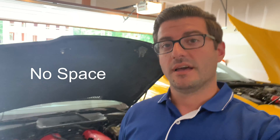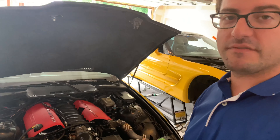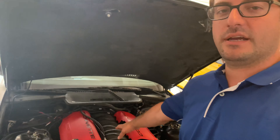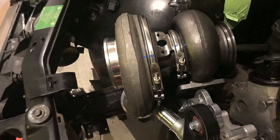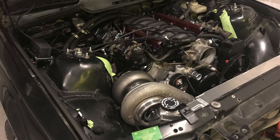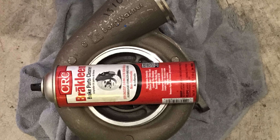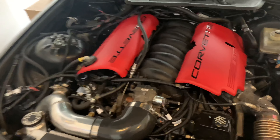One of the main reasons I had to do what I did was space. As you see here, it fits in — if I did the truck manifold on top, it wouldn't have fit. So I actually ended up having to get all Camaro accessories and an LS6 intake manifold to be able to have the hood shut. For space constraints, I had a problem fitting a sloppy-style turbo underneath the hood and barely had enough room to even measure a 78-75. So I actually went with a BorgWarner SXE 372.